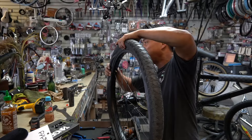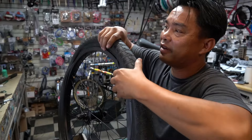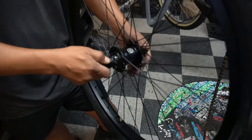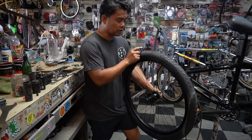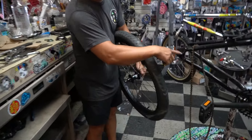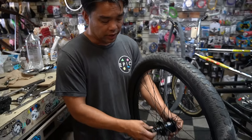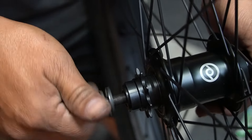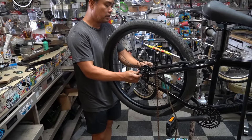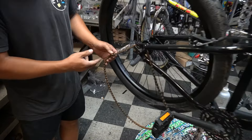So, the day in life - 26 inch free coaster, probably the first. But not all free coasters are going to fit this bike. The Primo one fits because the dropout is 3/8 inch. Most free coasters out there have a 14mm axle, but this one has a female axle so it's smaller. That's why we chose this one, and it's also one of the better ones out there. Pretty cool, I'm actually pretty excited to see it.